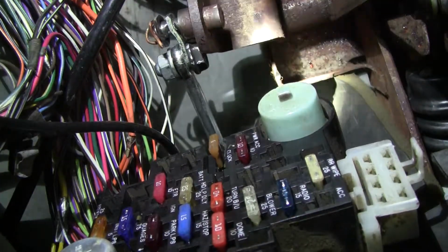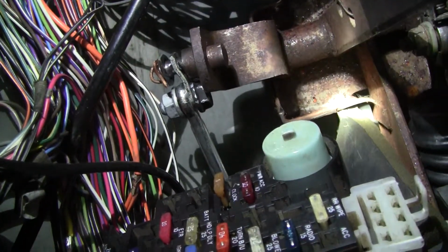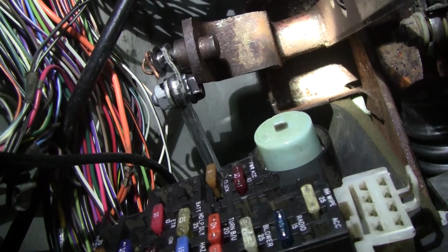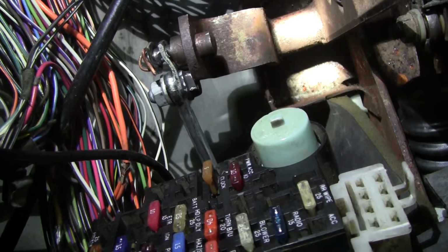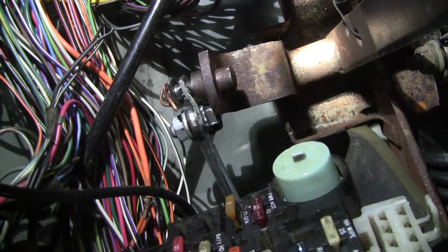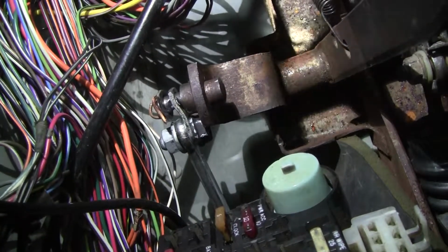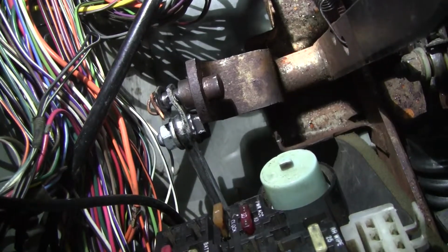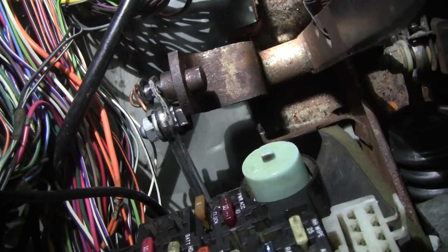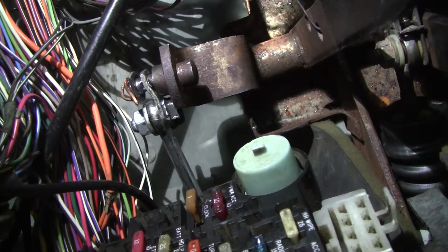It's a 2.5 liter AMC 4-cylinder. Anyway, so I found that and said, oh, well, no wonder the stupid pedal's way high. So that needs to get fixed. I think there's probably a bushing missing off of the pedal linkage there, but it's probably going to need a master and or a slave, or you just do both. This one, I don't think it has the plastic line between the master and slave. I'm not sure. It's metal underneath the vehicle. So anyway, that's kind of a big deal. The clutch shakes real bad, and this is just some more jerry-rig stuff.